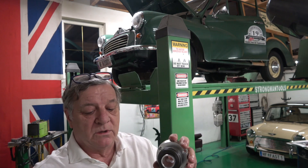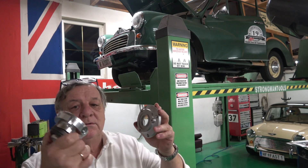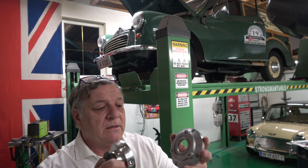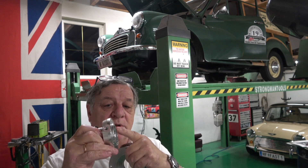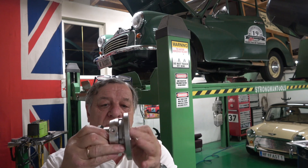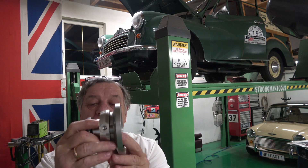The problem is we don't know quite yet. I've been told from Bernard that the guy who came up with this kit said it's going to need a 3mm spacer between here and here. Fortunately that shoulder is 4mm, so it will still leave 1mm inside. We need to make a 3mm shim to stand it off at that distance just inside, and we hope that will be the right distance - we'll check it out first.